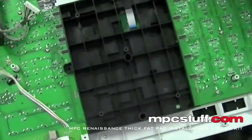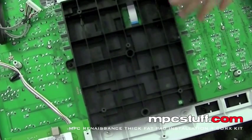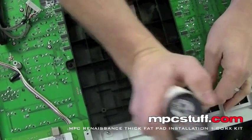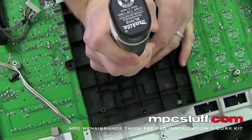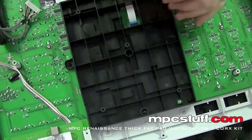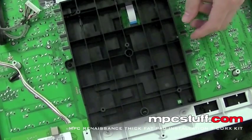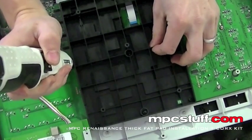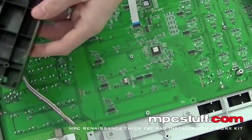This I'm going to take off first. This one has different screws than the rest of the screws in the Renaissance. You'll see here, here, here, here, here, here, and here — you have these black screws. What I always do is when I take those black ones out, I put them in a separate area, or sometimes you can even keep them in the tray. I'm going to take each one out but not completely pull it out — I'm going to leave it available in this tray so that when I put it back on I know that's where they went. Be careful, there's little holes where they can fall out of the tray, so just make sure when you're pulling this tray out. There's one right here too that I forgot — those kind of stay with the tray. Just make sure when you pull this off and you put it aside that you don't lose any.